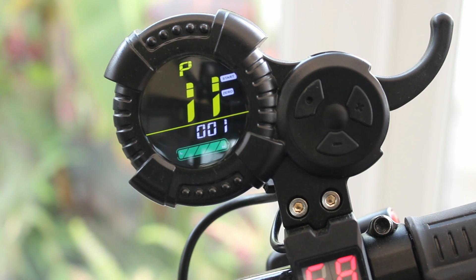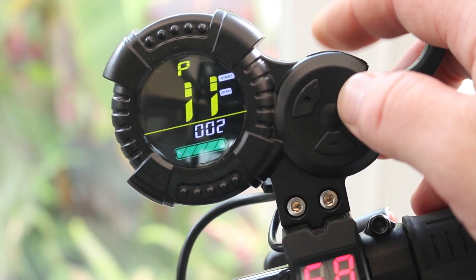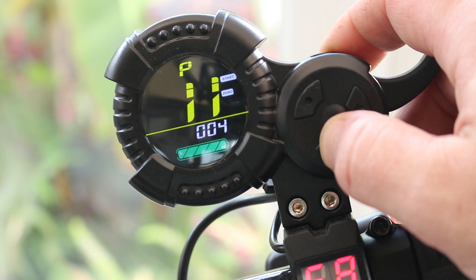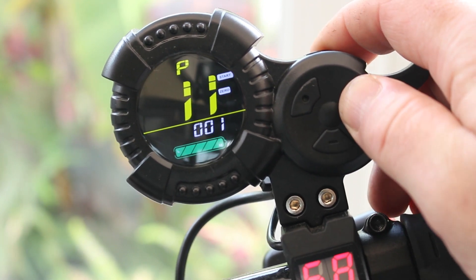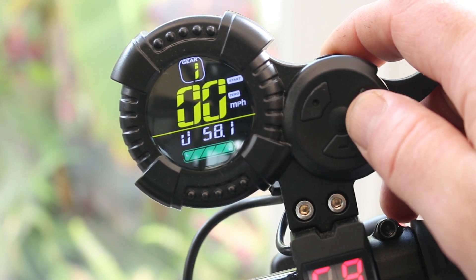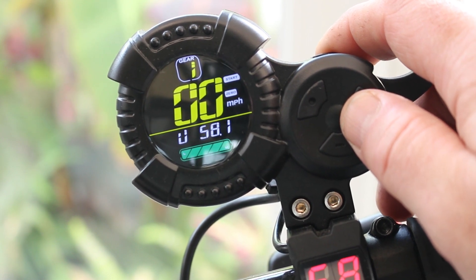P11 is the electronic braking. I don't have mine on, but the higher the number the more the electronic braking will be. For me that's next to nothing, but for you you might want your electronic braking on most of the time, or if you're in a situation where you're going to have a little bit of a race you might want to take it off.